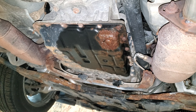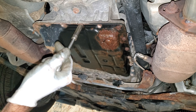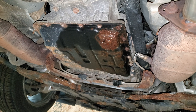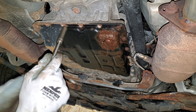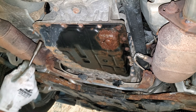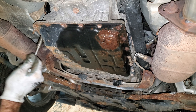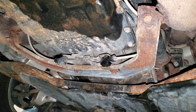The thing's pretty much all done dribbling. I can kind of see why the dealer says they replace the bolts too, because they're kind of rusted out. They're all 10 millimeters. This is all pretty self-explanatory after this — I just need to take all these bolts off. There's a couple of hangers on here with oxygen sensor wires on them. There's a bracket here for the catalytic converters and the bolts are so rusted out they're not even going to come out unless I torch them.